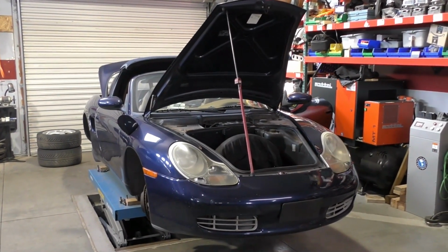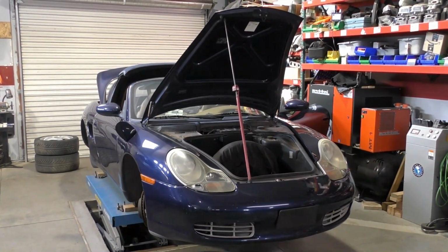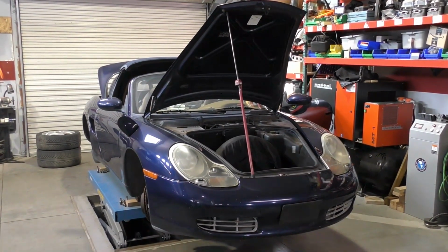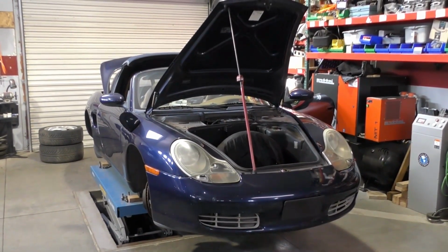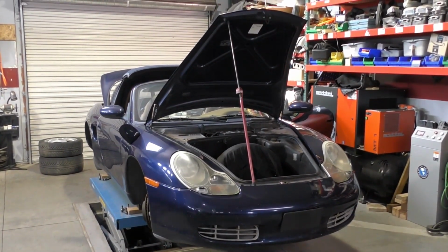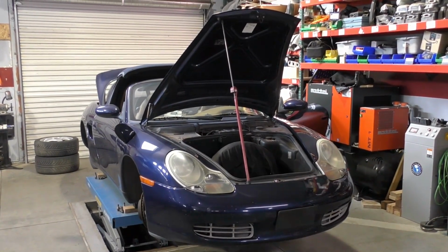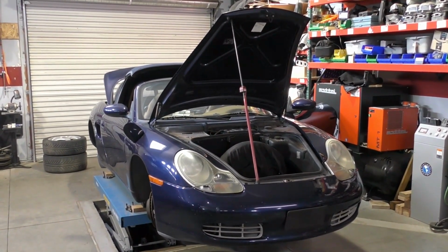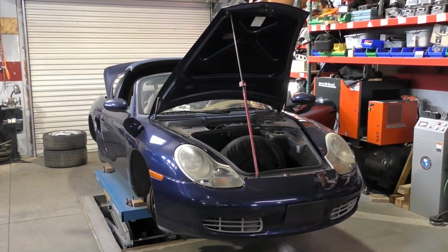Now, I don't want to just start the engine and run it, not knowing anything about it, to look at why the cooling fans were operating or not operating correctly. But it's quite possible that the water pump was not pumping and circulating the fluid well enough, and I can resolve that problem with a problem I can already see or feel on the car. So I want to fix everything that I can see first, then start the car and see what other issues come up.